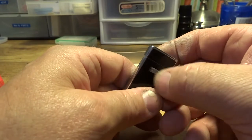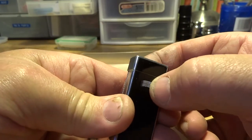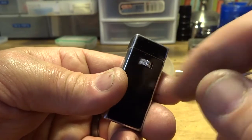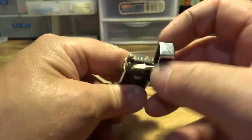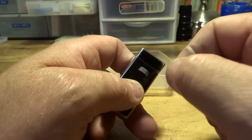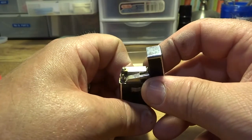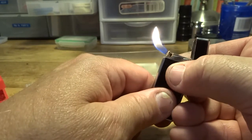But that's why I adjust it for the highest flame, because the turn it down goes this way, okay? Now I obviously can't adjust it on a low flame and leave that little stopper, because remember that little wheel here has a little brass peg on the bottom of it, and a screw on it. Otherwise, if yours doesn't have a screw, some of these just have a little square peg they just kind of fit down on, and they don't have any kind of a screw. So once you put them down on there, they pretty well work, but they're loose. This one here isn't loose. That's why I like this, and this is smooth and operates good. But this is number 273. Obviously, they've changed a few things to help cut down on manufacturing of them.